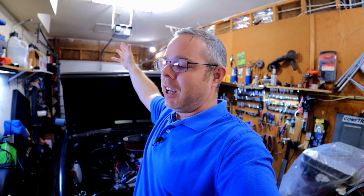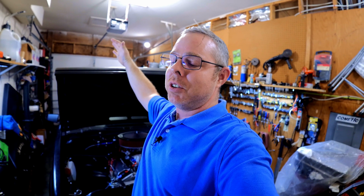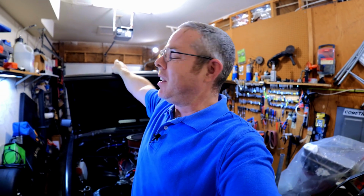I took it for a ride, and I apologize, guys, I didn't put this on video, but it did feel like it was hooking a good bit better with the Nittos. Nittos don't hook up very good at all, and they're actually holding pretty decently in second gear. So the next thing we're going to do, I'm going to put the 1-inch extended travel ball joints in the front, and then we'll reset up the shocks in the front also.